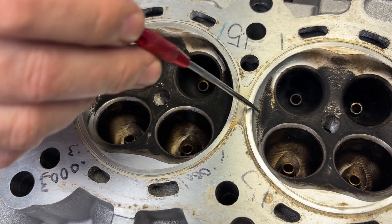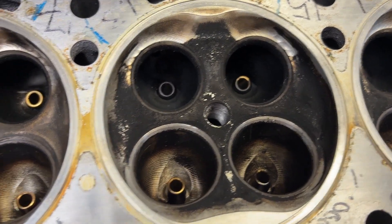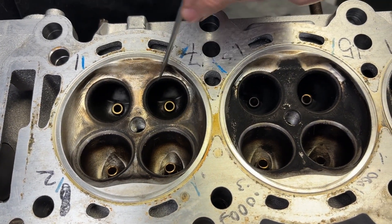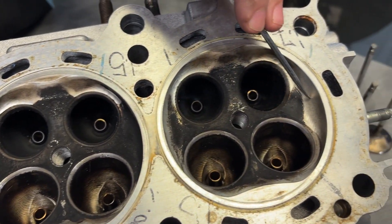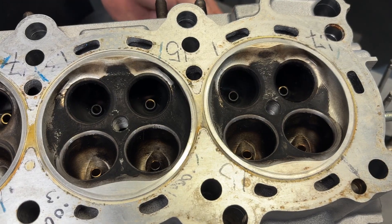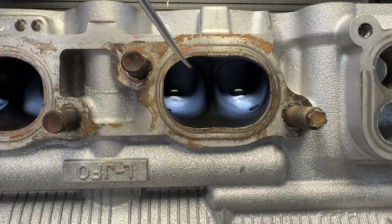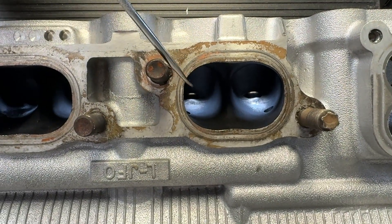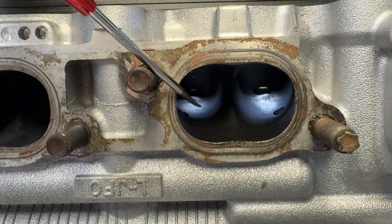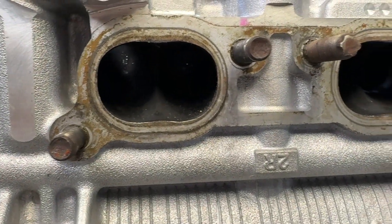You also see a lot of oil, but notice how this side is clean, this one is oily, and then this one is pretty clean. What this tells us is that there was definitely some water — antifreeze or something — that entered the combustion chamber. That's how it gets cleaned; it doesn't get cleaned unless that happens. And this one was just oiling its face off and all the oil went through the exhaust port. Notice how gigantic the exhaust port is — somebody thinks you can open the head up by the gasket and it instantly flows better, but they left the guide bosses in, so the port is actually smaller inside. It's just made real big on the exit, which makes zero sense.